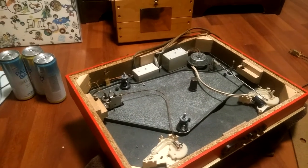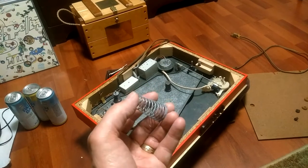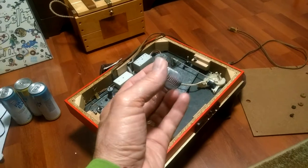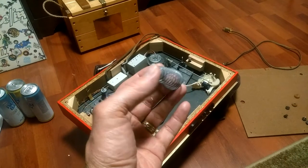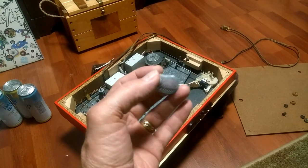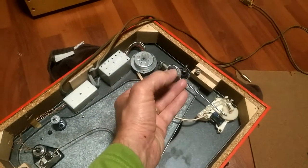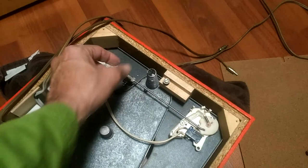The other part Dave does when he does his setups is finding the weak side of the spring, which is pretty easy to tell — you can tell by how easily it curls over, which is the stiff side and which is the loose or floppy side. That's the stiff side there, and on the opposite side is actually the floppy side. What they say is on the floppy side, you face that towards the inside spindle, so we put the spring on basically facing that side.